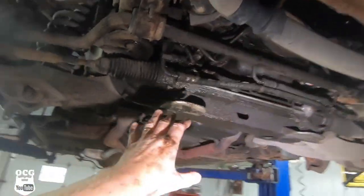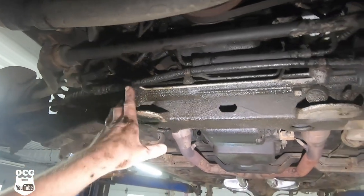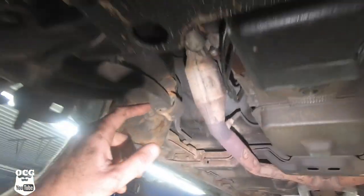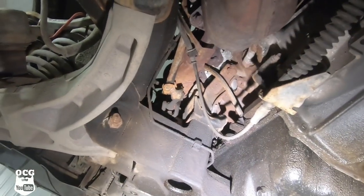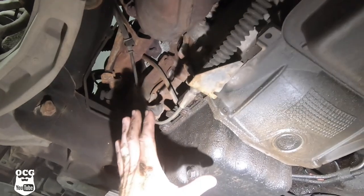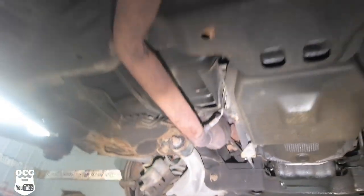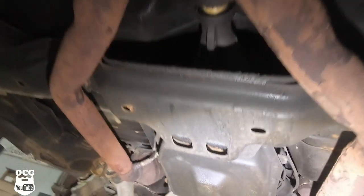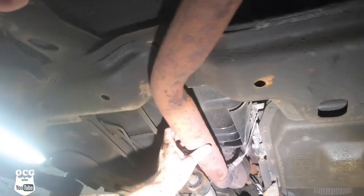Let's go underneath and I'll show you some things. First, there's a pretty good oil leak up front — we've sprayed it with brake cleaner but we don't know yet if it's power steering fluid, engine oil, or transmission fluid. We're going to clean it up, start the car, and see what gets wet. The base pan is wet a little bit; I went around and tightened some of the bolts holding it on — got about a turn on some of them — so hopefully it's just a little weepage from there. Also, you guys asked about the exhaust: we've got an X-pipe built in here, and someone along the way has cut out the rear cats — they're just gone, straight pipe into the X-pipe.